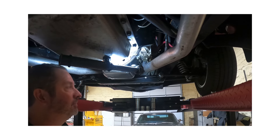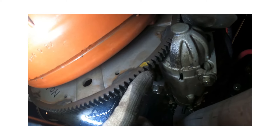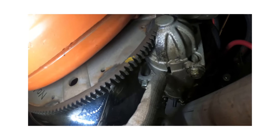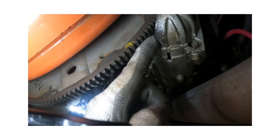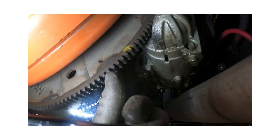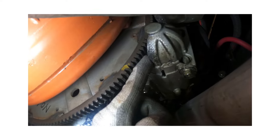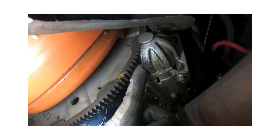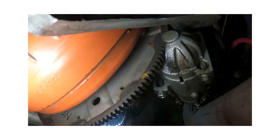On a lot of your GM stuff, you've got to look and see where the Bendix engages with your flywheel. I can see where they put some washers and tried to shim this thing down. There's actually a shim kit for these. You use a paper clip — when that Bendix pinion gear engages, you want about a paper clip's worth of clearance between the teeth of the flex plate or flywheel and the pinion on the starter. That's how you shim them to get proper engagement. I can tell it looks like it's shimmed out too far.